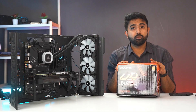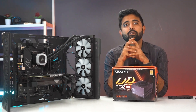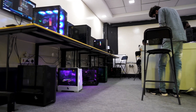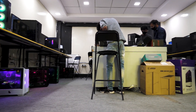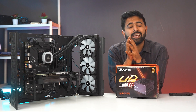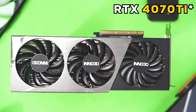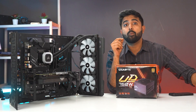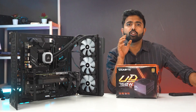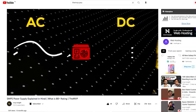So we're going to put this unit through a hardcore stress test and give you a science-backed review. Generally speaking, people use a power supply to supply power, but we wanted to make this test more accessible. The first method is putting all the PC components on high load for a very long time, so we can monitor the power delivery to see if there are any abnormalities. The configuration we chose is an i9-13900K with an RTX 4080, and this system can actually draw more than 750W.